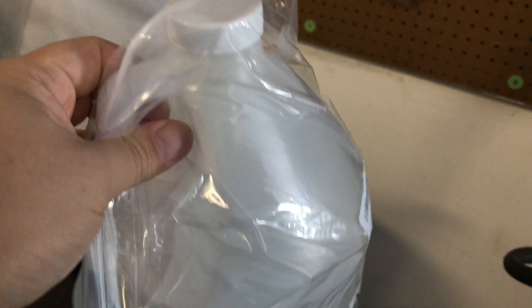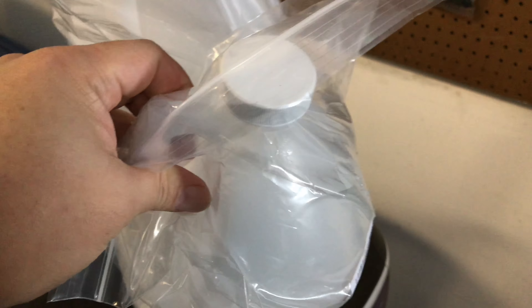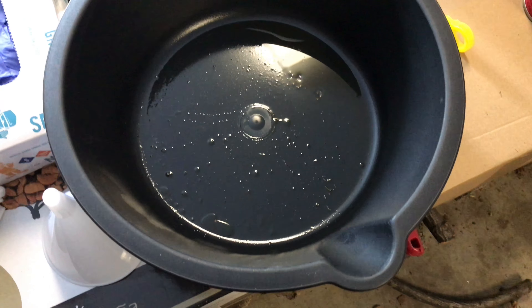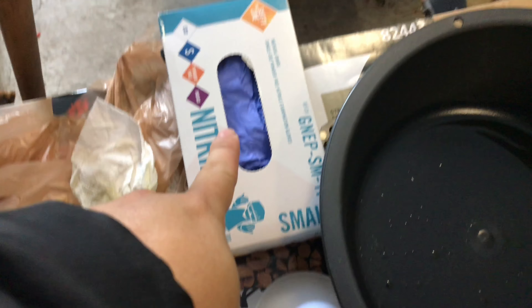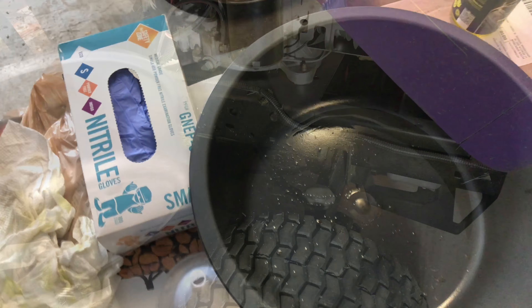I think this is the drain plug right there — it's like a half inch square bolt — and then we fill it with oil right there. I also have some empty containers which eventually I'll put the oil into, because I recycle this oil through our SWALCO that takes the old material. I also have a pan here with a nice little spout to pour it into things, a funnel, and also some nitrile gloves. I think that's all we'll need — let's get changing.